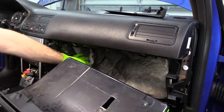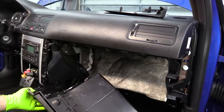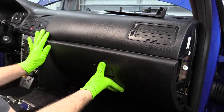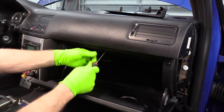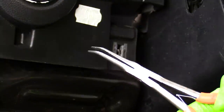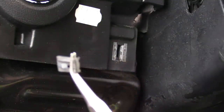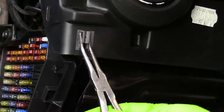Now that we have our bezel and everything in, let's work on the other side. We'll start with our glove box. Make sure you plug your light in, and if you have an air-conditioned glove box make sure you put the hose on it. Once plugged in, lift the glove box up into place and get our six screws in — three on the inside at the top and three along the bottom. Our new trim pieces come with clips; the easiest way to remove the old ones is to take a pair of bent pliers, go on the outside of the clip, get up high on it, and rock it out. I like to save these because you never know when you're going to need an extra one.